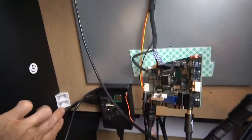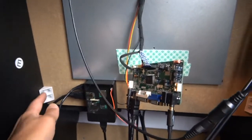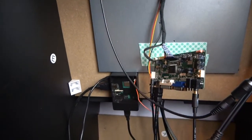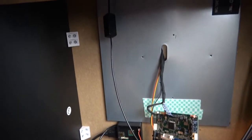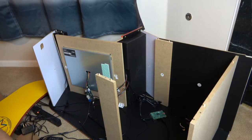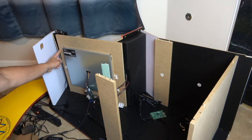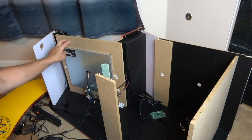Right here, for the most part you're going to have to unscrew four brackets — you can leave the screws in the cabinet, you just have to take out the two screws on each side of the monitor, so that's eight screws total. Then there are another two you have to take out that attach up near where the marquee goes. Here you can see I have one side panel off, and there are two screws up at the top near the marquee you have to take off as well.